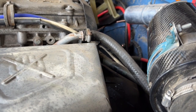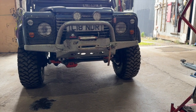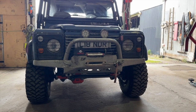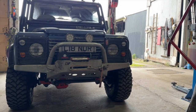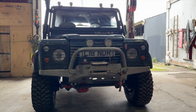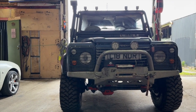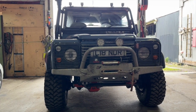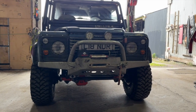I'll run it and see what happens. It's been there 10 minutes now and there's no water on the floor, so I'm guessing it was that pipe and we have resolved it. Thank God for that. I've also been mucking about with pressures and heights. To get it pretty much halfway between its travel, I need 60 PSI in the front bags and 50 PSI in the rear. Obviously with me — a great fatty — sat in the front, I might need to just alter it a little bit. But that's about right, so that puts us halfway between our travel.